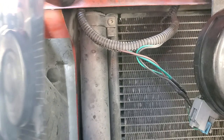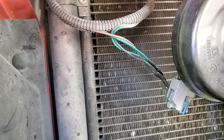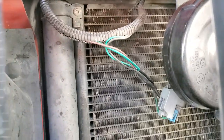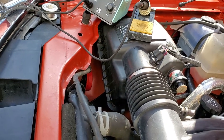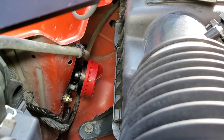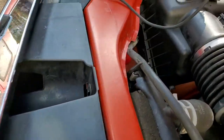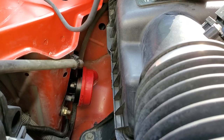I'm going to finish up with some more wiring loom. I soldered an extra set of wires that go beyond the radiator right there, inside the engine compartment. And then I'm mounting the horn right here, right next to the airbox. There's already a hole right there — you don't have to drill anything. Just get a good-sized inch-and-a-half bolt or something and some washers and a nut, and you can mount the horn right there. You're talking 18 inches at the most from the existing horn to your secondary horn.